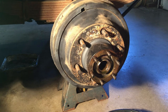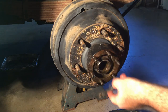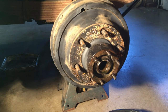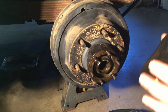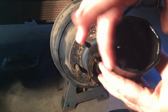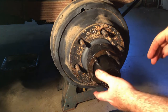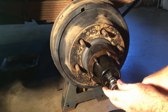Normally people take a chisel and a hammer and slowly chisel that nut off — I could see on the nut where I or somebody else had done that before. This time I was smarter and got the correct axle nut socket ahead of time. It's still a two and nine-sixteenth, but if you look at that nut it's an eight-sided nut versus a hex or six-sided one. You're going to need an axle nut socket with eight sides, not just six. It was only about thirty dollars online — definitely worth buying, as I may need to do this a few more times in my lifetime.